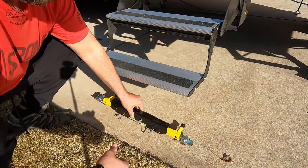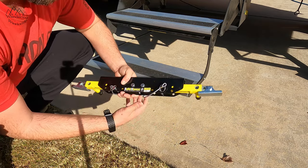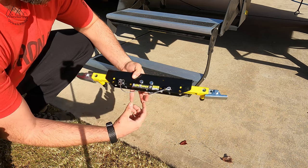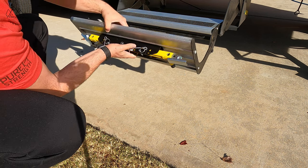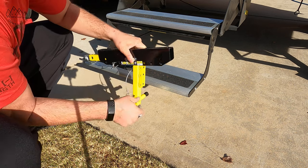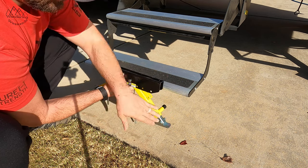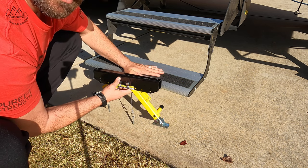Let me show you the basic gist of how this works. Here's the part — pretty nice build quality, I'm very happy with it. I love how the cable is attached to the pins so you won't lose them. In a nutshell, we're just going to bolt this to the bottom of your bottom step, and then when you get to your campsite, these pins pull out and it sits down. You can then extend these legs to sit flush on the ground, giving you a solid bottom step.